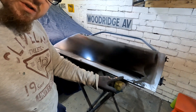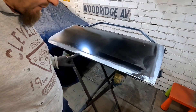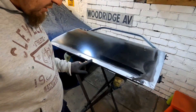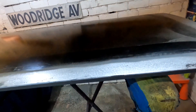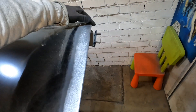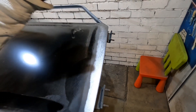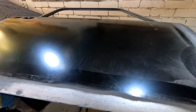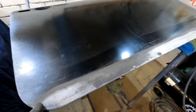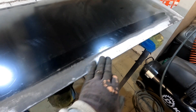If you look along here, I'm sanding to try and get it as straight as possible. When I tapped it round I've dented it there and there, so it's a little bit low on either side. It's not too bad but you can see the flick in there where it cracks off. On the door I've tapped it down a bit so it doesn't hit - the air gap. I'm just sanding across here with some 80 grit to try and get it as flat as possible. I can feel the dent there, so I know what I've got to do with that.